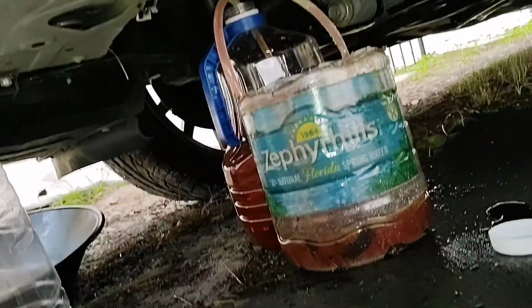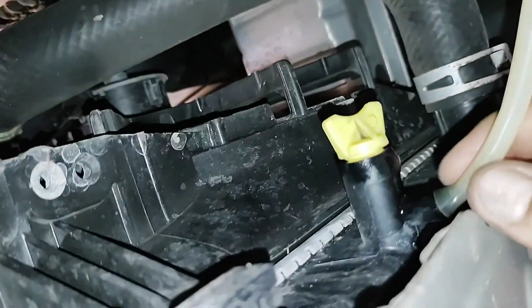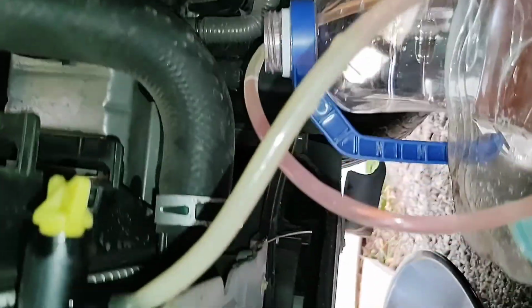What I have here is my pans that I use to collect the used antifreeze. Right? Here's your plug right here. You're just going to take your plug, and you see your plug has a connector. I just hook my hose up to the end of it, and you just unscrew it, and your fluid will come out. But what I'm going to do now is I've already drained it, as you can see. Now I need to flush it out, right?